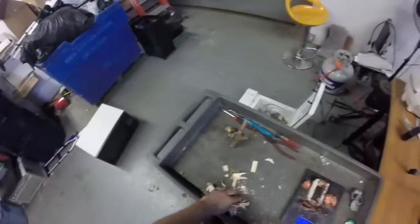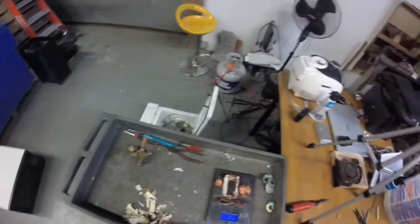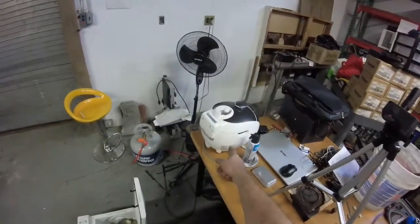At least this way there won't be as many impurities inside the crucible when you try to pour the copper. You can always use borax to get the impurities to one place and then scoop it off with a ladle, which is normally what I do. But the more you clean it, the better off you are. Anyways, that concludes scrapping that microwave and I'm going to go ahead and start off on that rice maker in the next portion of the video.